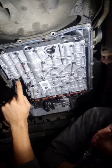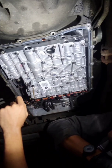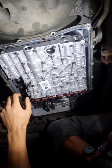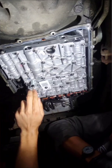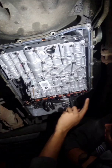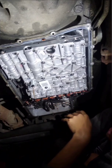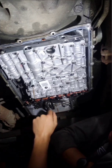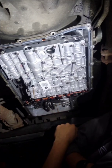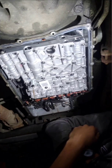The hardest part is getting this guy back plugged in — that was honestly the hardest part of putting this back in. Make sure all your connections are good: there are four connections plus the solenoids. Go through, tighten your bolts back up, and I think I'm good to go — just going to wipe this around off and get the gasket ready.